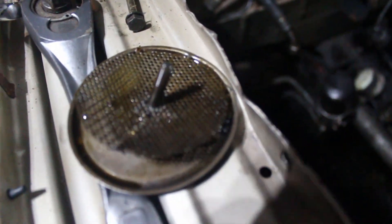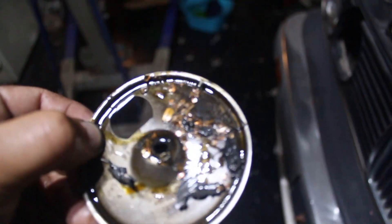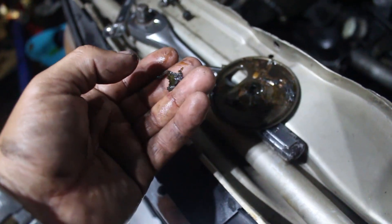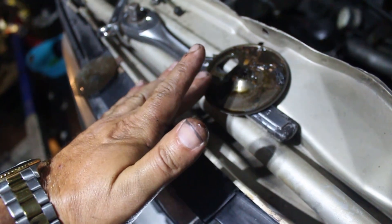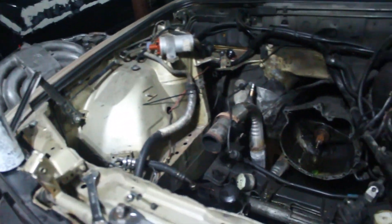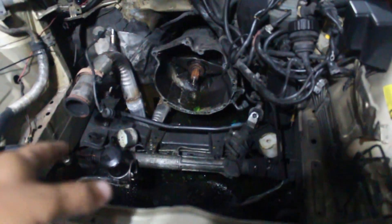Alright, I got the oil pump removed and the first bit of carnage I saw — let me take it over into some light, it's pretty bad. We lift this screen up right here and holy crap, look at all that. Some of this is just Permatex, and honestly I learned from my mistake because this is probably what caused all of this. We installed that oil pan with the engine still in the car and it was a very, very tight fit.